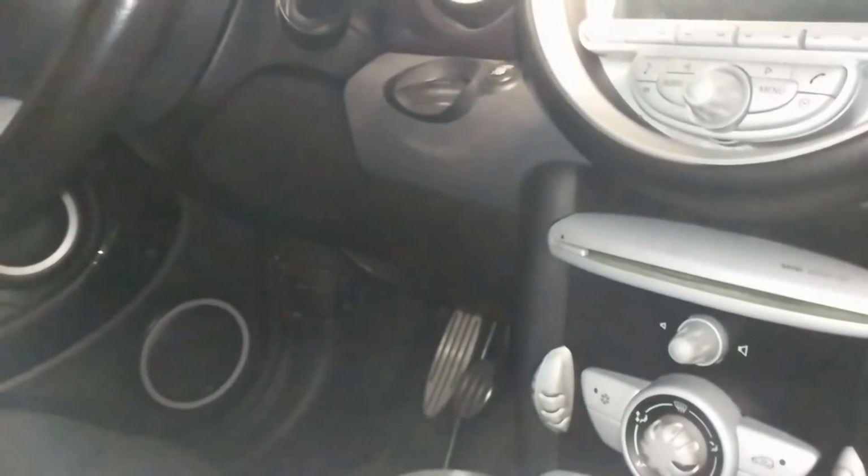So we're just going to splice in the OEM wiring with our new harness and basically one wire connects to the new starter off the GSX, which is an older car, and then it'll start, which is awesome. I don't need the OEM ECU in to trigger the starter. There's no safeguards, so that window doesn't work. It's set right now to key on, so as soon as that key comes on, this thing will activate.